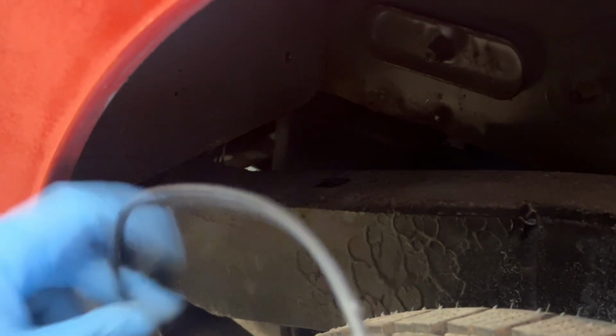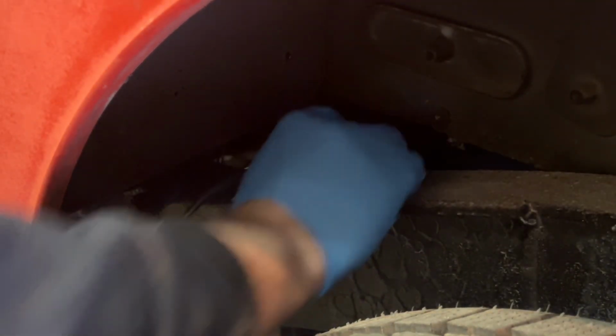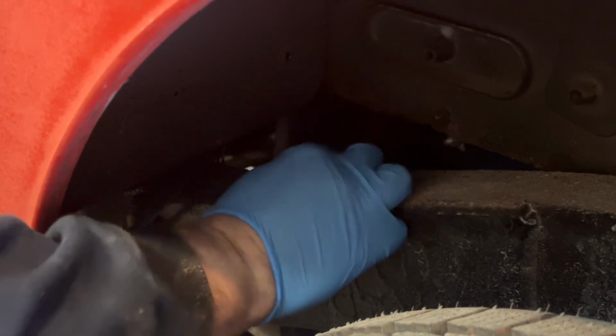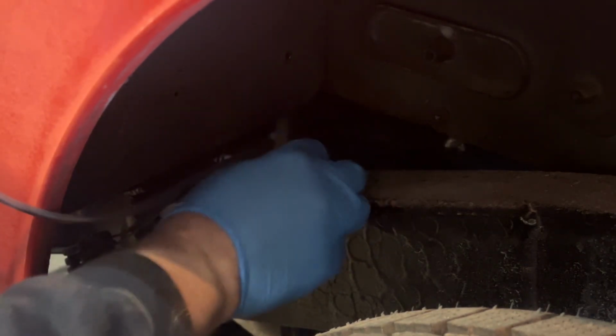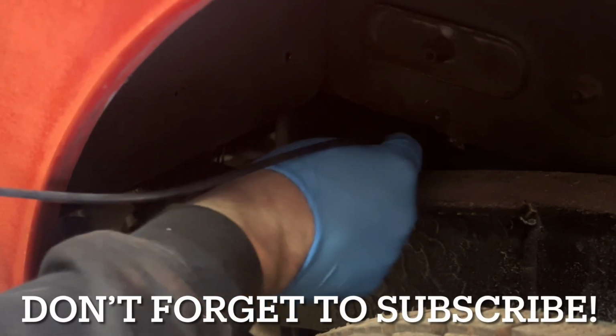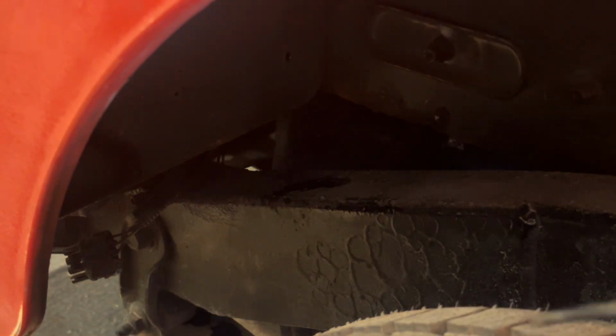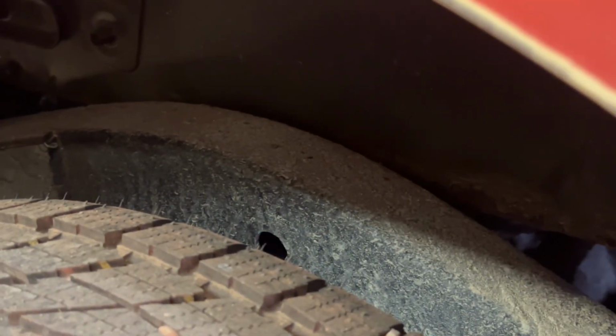All right, from here on out, I've got my respirator on, and I'm just going to start moving that tube inside the frame. I'm starting from the back and working my way towards the front. I think the most important thing is to remember where you left off and then try to overlap on your next coat. So I'm going to go in towards the back as far as I can go, and then towards the front as far as I can go and pull that back, and then go to my next entry point, go back, and then go back towards the front.